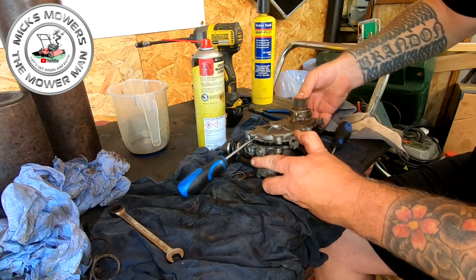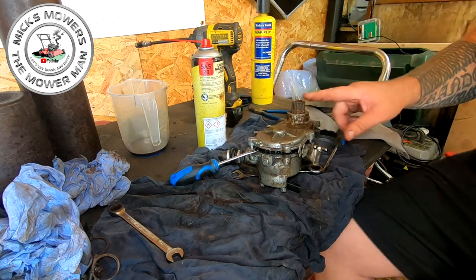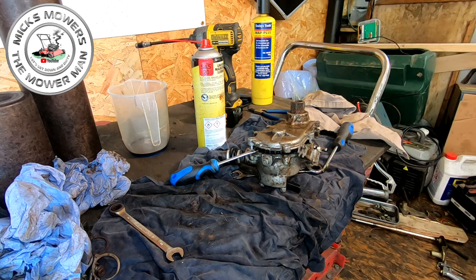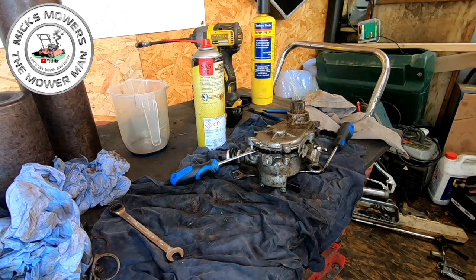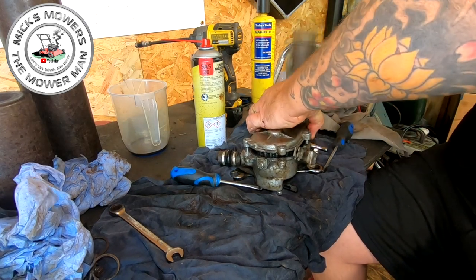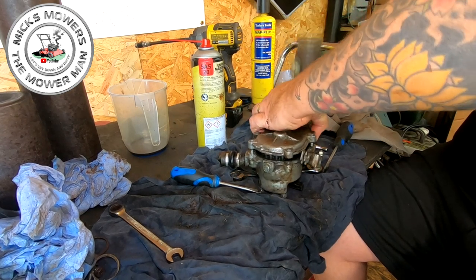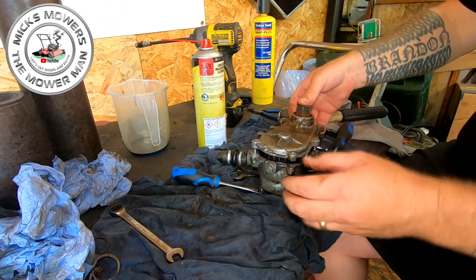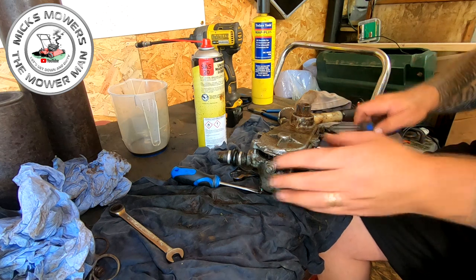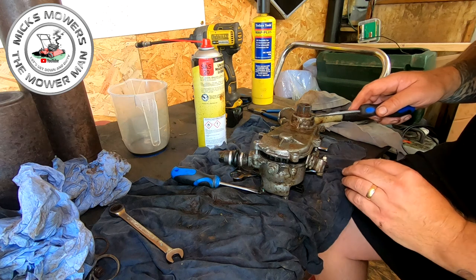What you're going to do is look for this to slide up over the top of this cog here. So you have to go just a bit careful. You can't just go wailing on it with a hammer because you're going to break the gearbox casing. But once you've got it sort of half separated, you can just give it a few gentle taps and it will start to come up. So it's starting to move. Just take your time with it. But you can see we're already starting to expose it. You don't want to be prying anywhere really, just little tiny lifts. You want this to roll up over top of this cam here.